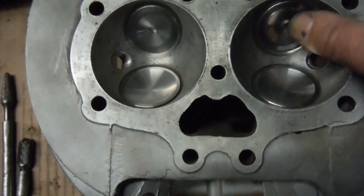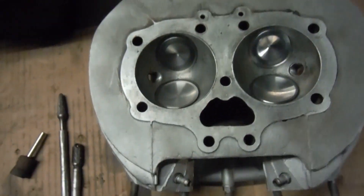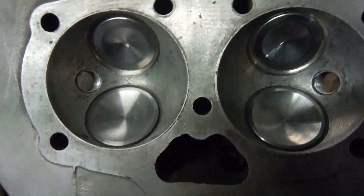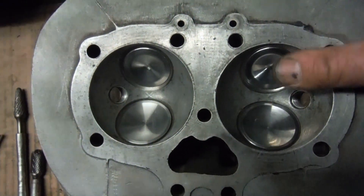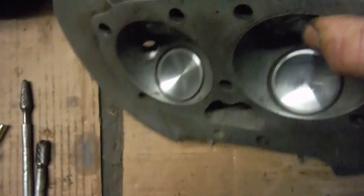The guides no longer fouled the exhaust valves from seating, so I was then able to cut the valve seats, grind the valves in, and finally fit them. There may be some footage of this cylinder head looking like something that was dredged out of a canal — it's come a long way.